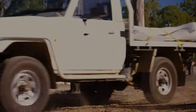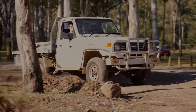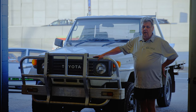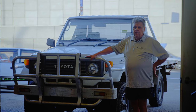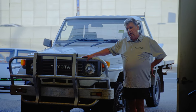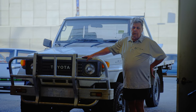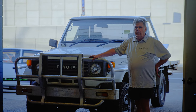The electric motor we put in here is around 300 horsepower and about a thousand newton metres of torque — by my reckoning, probably double what the car originally left with. It has that much torque we don't even bother using first, second, or third. We just take off in fourth gear and that takes us all the way up to highway cruising speed. If you want to be a little quick off the mark, just leave it in third gear — there's plenty enough revs in this electric motor to still do quite a good speed on the highway.